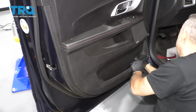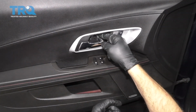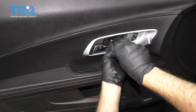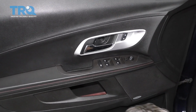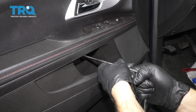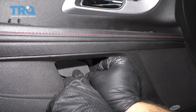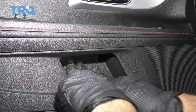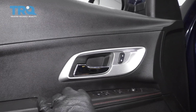What we're doing right now is resetting all of the door panel pins in the door panel surround. Reinstalling, putting the 7mm screw up in the top. You can go ahead and snug that right up. Next, we're going to move to the 8mm screws on the bottom. Your final steps for installing the door panel would be to place your trim bezel, your bolt caps into place, and snap them in. Take care of the upper one here. And that completes your window regulator installation.